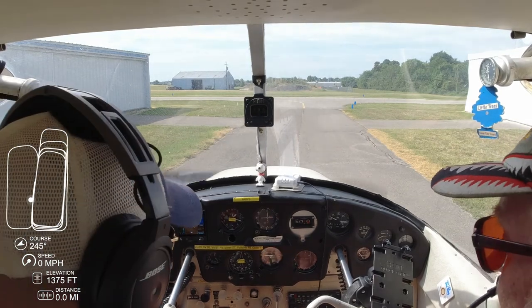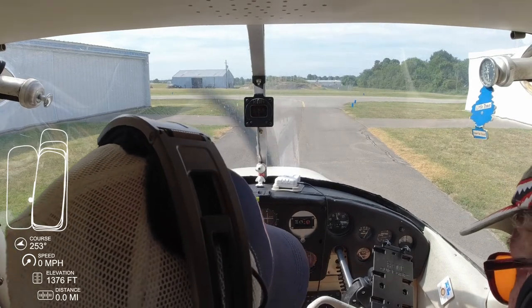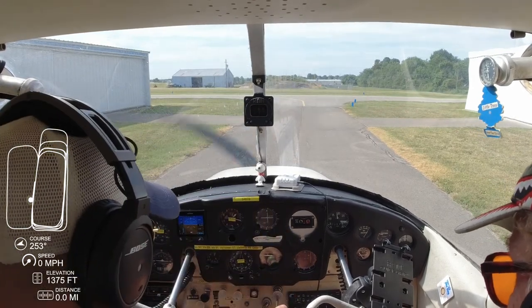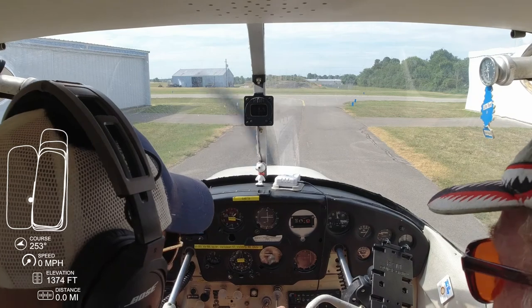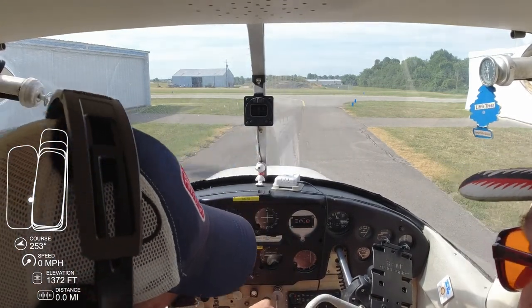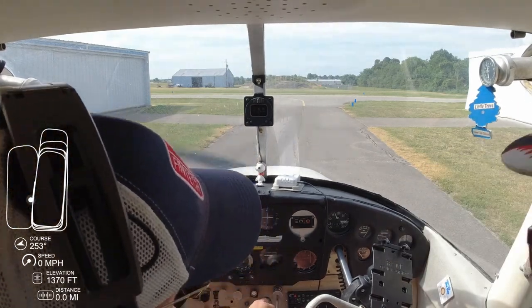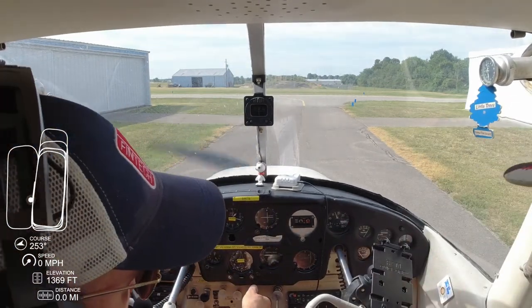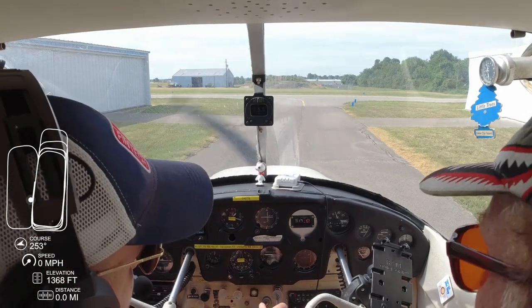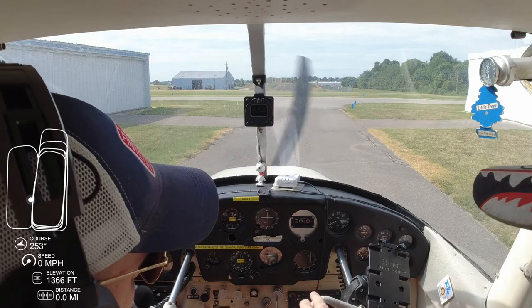All right, we'll run up, 1700. Yep. Okay, that's about 1800, that's okay. Check it. You're looking for a 100 RPM drop, or 125, and then 50 between the two. I just go one click to the left, back to both, two clicks to the left, I notice the drop, go back to both. Yep. And then carburetor heat, pull it back to idle, make sure it doesn't die. And then, did you do the flight controls already?